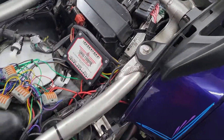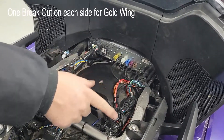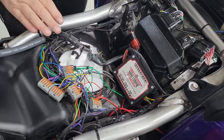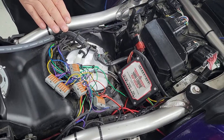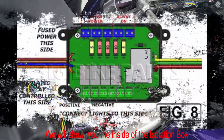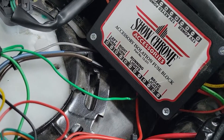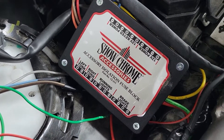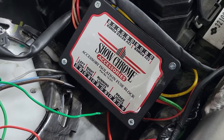On this bike the breakout is back here. All we've done is hook this in series with it, and it's got an output which is right here. Here's our signal isolator — this is on a Gold Wing. You'll see you've got brakes, running lights, right turn, left turn, and you even got power — keyed power and 12-volt. So if you want 12 volts all the time it's here; if you want keyed power it's there. Anything for running your lights and accessories while the bike is running is right here.